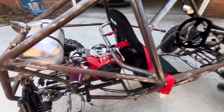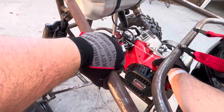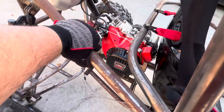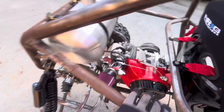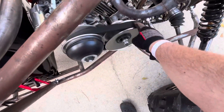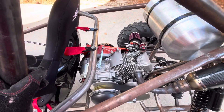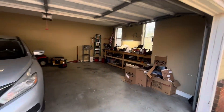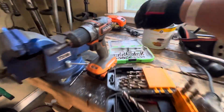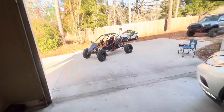You can shift the engine. That belt is already engaging the clutch. I think I need heavier springs in the driven clutch unit — stiffer springs to keep it from opening up so quickly, because I've never test driven this clutch.